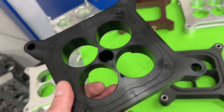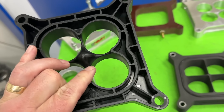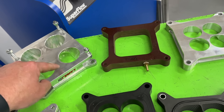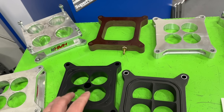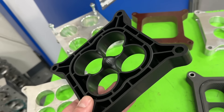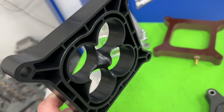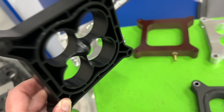Of all these spacers, this is actually the cheapest one. It comes from AFR — a four-hole taper, slightly tapered with a cone in the center, phenolic, about 45 bucks. When I tested all these spacers, this AFR was the best one and it's been used on several different manifolds. It has always been the best spacer for a 4150 flange intake manifold.